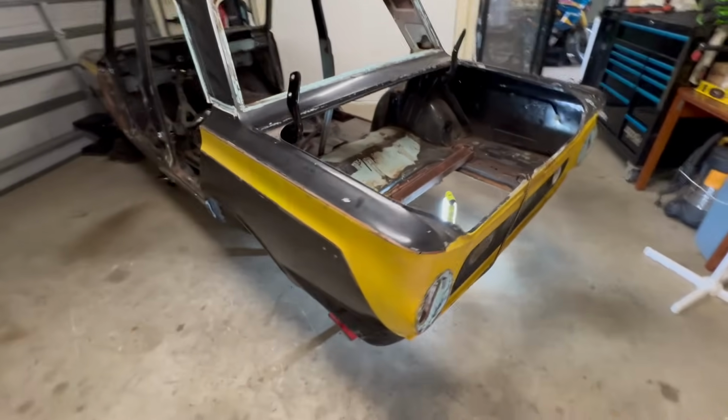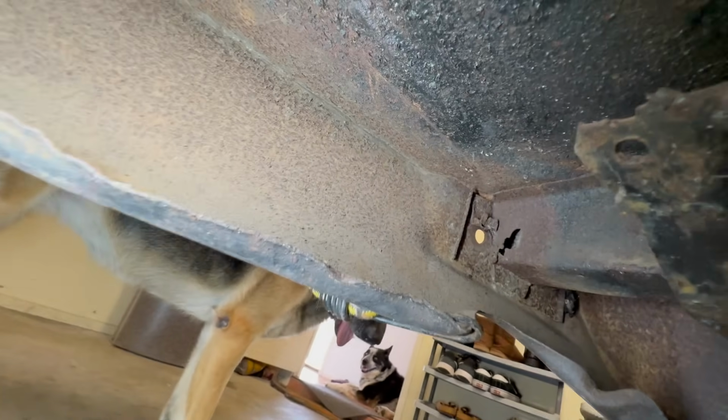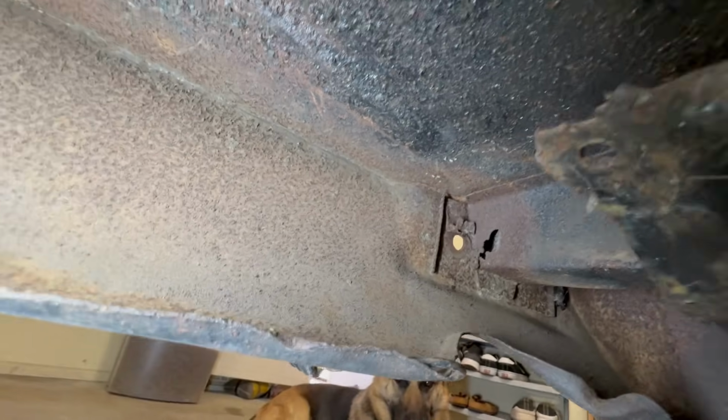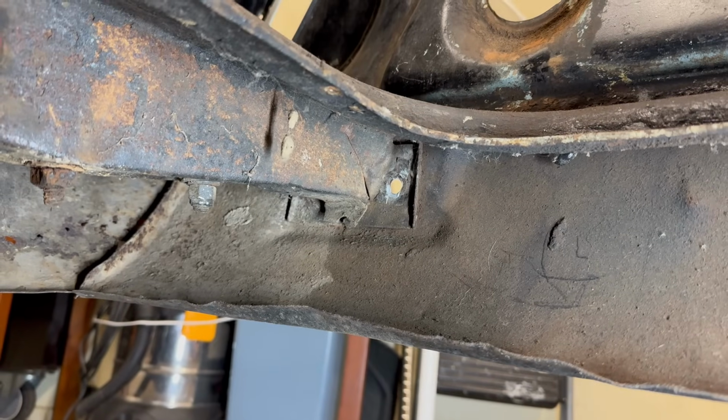We're back. It's another new day now. It's New Year's Eve. These rear mounts have thrown a little bit of a spanner in the works. If we have a look here, this rear mount, which I was going to attach to, it looks like there's a few compromised parts in it, but what's actually worse is the other side. It might be hard to see, but there's a bit of a crack.